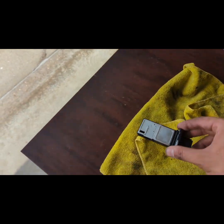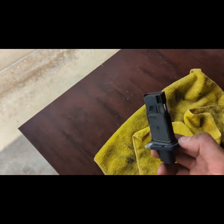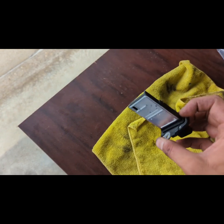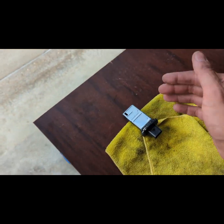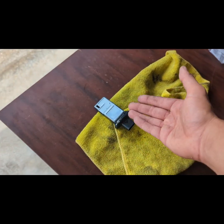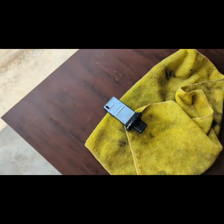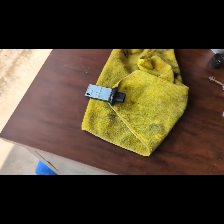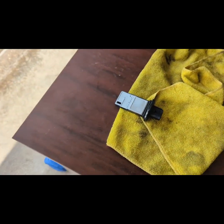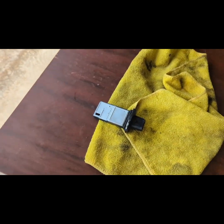That's how I keep the throttle response really good and the engine idle healthy. If you're having any hesitation, sluggish performance, issues with downshifting, or a significant decrease in fuel economy, this is the part to clean. Really easy, really simple — on 2005 to 2011 Panther platform vehicles across the board.